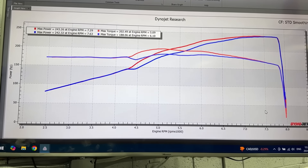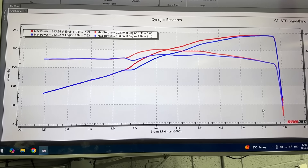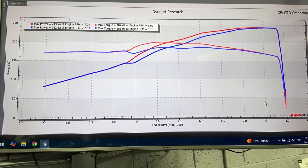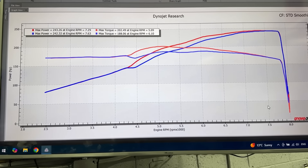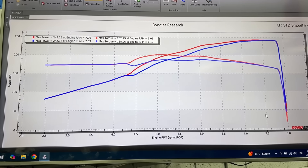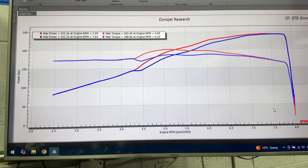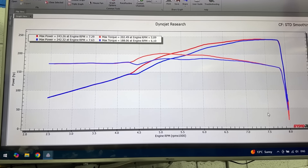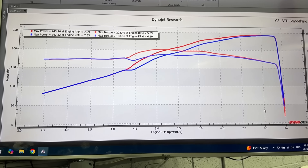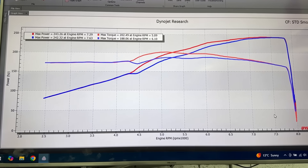Tapering from 40 degrees VTC down to 25 degrees VTC made the most power, and that's what we ended up with. In blue is just 25 degrees straight across — you lose a whole bunch of mid-range power. In this case I left VTEC at 4,400 just to show you how much power you would lose. If you had only the 25-degree VTC cam gear you'd probably end up having to engage VTEC at around 4,600–4,700 RPM, and you lose all that power under the curve.